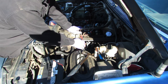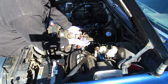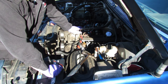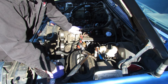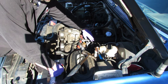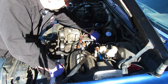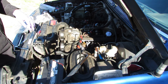That's how the injectors get installed — the rest are just like that. I also went ahead and pulled out the glow plugs while I had all the injectors out, so I can blow the fuel and oil out of the combustion chamber before starting it up. I'll turn it over by hand first. So before we get the injectors completely installed, I removed all the glow plugs. They're located — hopefully you can see — let me get you in there.